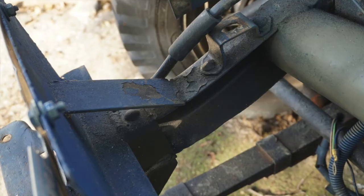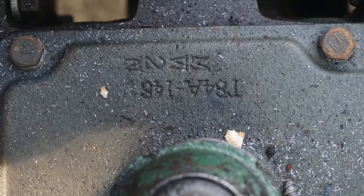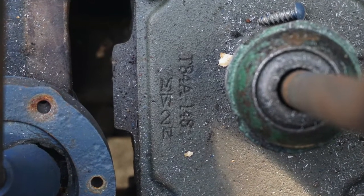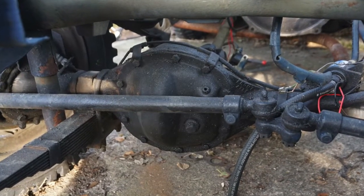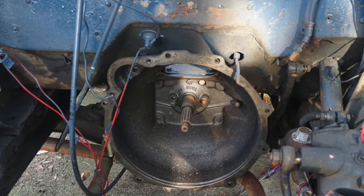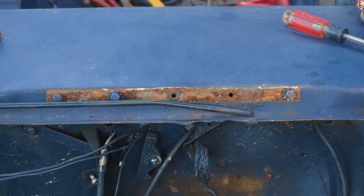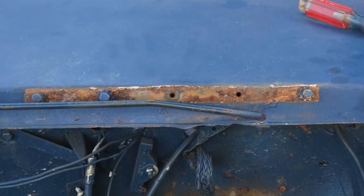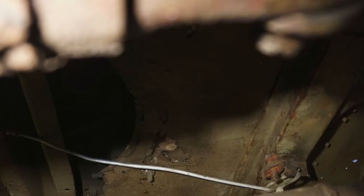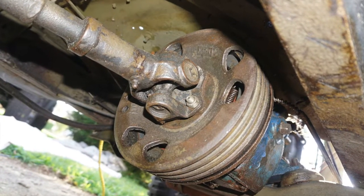Gibbs Oil — it's great. There's the front license plate bracket, someone welded to the frame. There's the T-84 transmission — you guys probably know more about that transmission than I do, but at least it's a wartime transmission, I hope. Front axle. There's the bell housing. Engine's already on a stand, as you saw in the previous video. Yep, I'm just showing you the condition of the Jeep right now. Underneath, there's a part of the body being welded to the frame — that's fun to deal with. There's the rotted floor underneath the sheet steel. The handbrake right there.